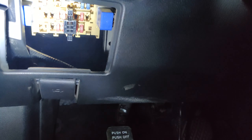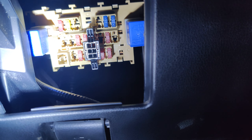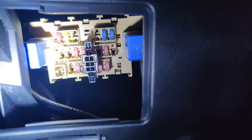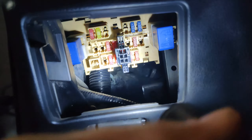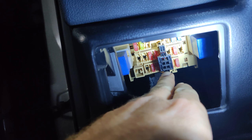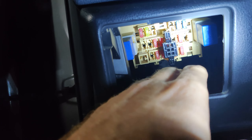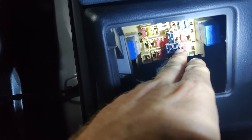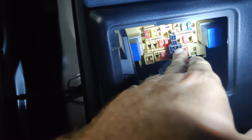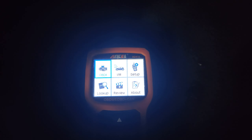Where I do have a fuse panel though, is right here. And when I popped off this cover, I realized that this fuse right here — or fuse holder — is not even pushed in all the way; it's just kind of dangling here. I don't know why it's dangling there, but as soon as I pushed it in, I can now look down and I'm getting power to the OBD2 port.